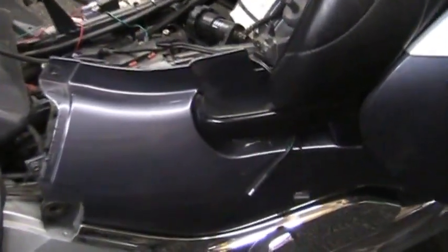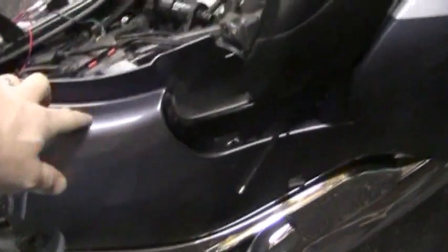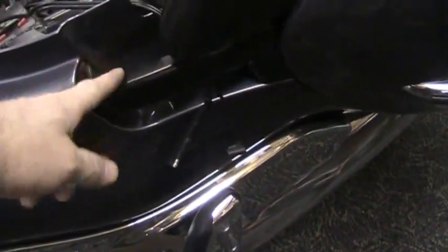Okay, so in this part of the video, I'm going to change the fluid, flush out the fluid out of the ABS unit on this 2000 K1200LT. And in order to do that, I need to pull off some panels. So I need to pull off these side panels here. There we go. To pull off the side panels, I'm going to take off this handlebar, this lift bar here,